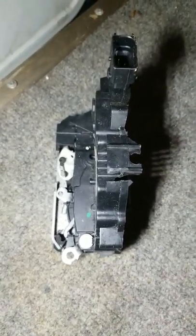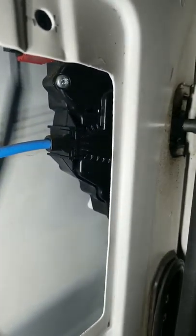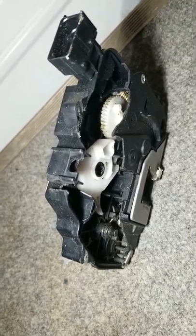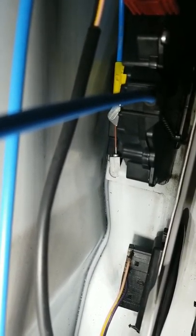What I had to do — if you take a look at the one I have and orient it the same way, this is the way it was on there. The bottom one is the one that actually opens up the door. To take it apart you actually got to take it off the door. The only challenge is if the door won't open, you can't get the screws out because the screws are for the latch. I ended up having to take a screwdriver and a hammer and bust that whole mechanism apart, while it was in place. From there I was able to figure out which one was the bottom linkage — the one that opens the door. I'll demonstrate it here. That bottom mechanism there, if you hit that one — it takes a little effort — that opens up the door.